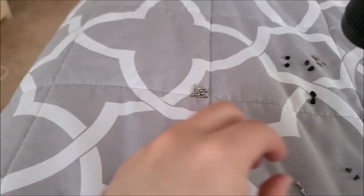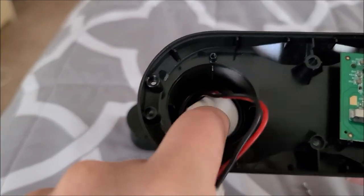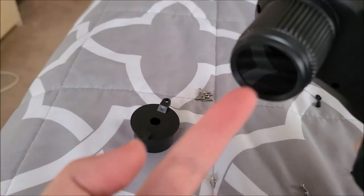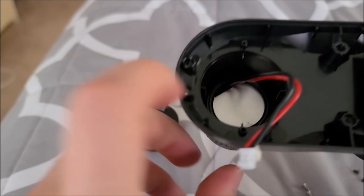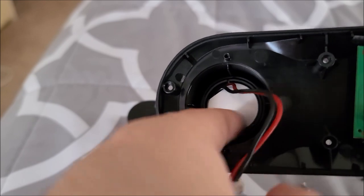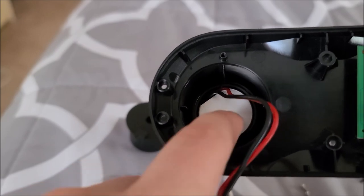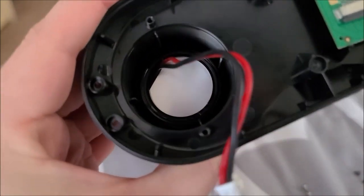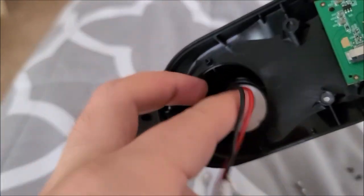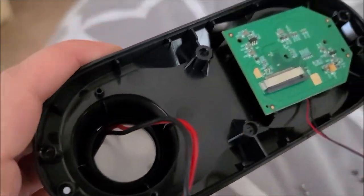Okay, so unfortunately I pulled off this little plate that was covering the IR LED, and it looks like it's not potted, but glued in there. And it's somehow inserted from the front, so I don't think I could get into there non-destructively. There might actually be this ring. Yeah, I can see it's kind of screwed, and then there's a bit of glue in there to hold it in. So it's just going to be an aluminum clad PCB, and the IR LED is in there. I might be able to get in if I had a tool that could grab those notches and unscrew it, but it looks like there is some adhesive there as well, so it might end up breaking the plastic on that one.